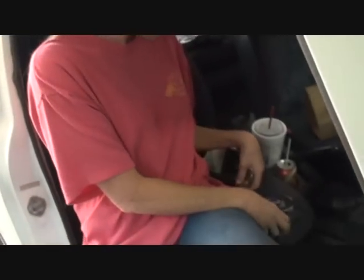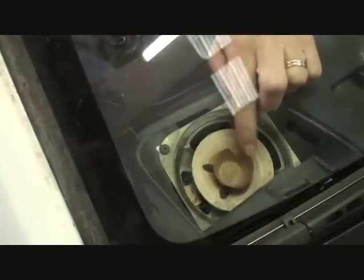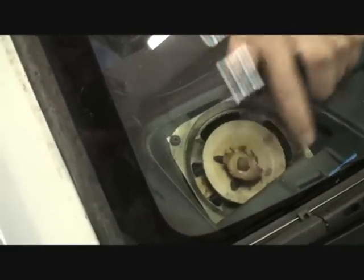And what do the speakers that were in there look like? Do you have anything we can look at? Or do you want to wait until you take the old one out? Well, you'll just come around this way and you can see. Okay, so this speaker here, is it basically on the windshield? Right. It's in my dash. And all you got to do is pop up the cover. It's just real easy. Just pop it up. The microphone's out here, so you're going to have to talk a little louder. Just unpop it. And as you can see, it's really old. Look at that. So that speaker's worn out.